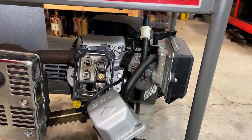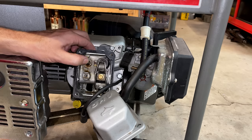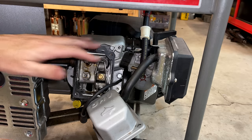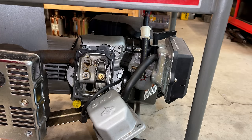You know, I was going to take a look to see if maybe it was getting stuck on the ignition coil, preventing the engine from turning over. But regardless, there's a stuck valve. I'm sure it's rusted in there pretty good. And that has to be dealt with. So, yeah, let's get the tank out of the way. We'll get the exhaust, the carburetor, and this tin off, and then get the head pulled off.